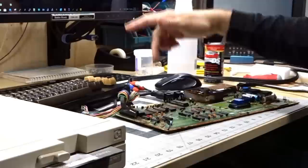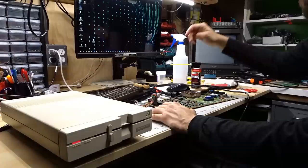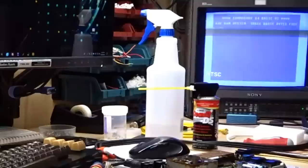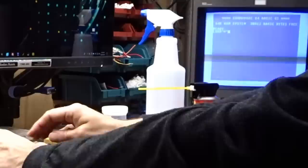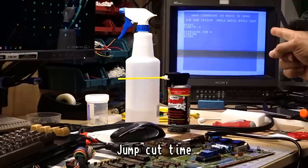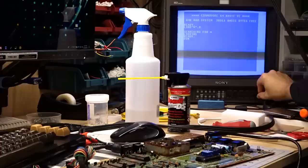It's full-on test time. I have a 1571 disk drive connected to the IEC port on the rusted motherboard, and my favorite SID music disk. The video and audio are hooked up to my Sony PVM. I do have a couple of heat sinks on the VIC-2 chip, just because they get hot. I turned it on, the disk drive accessed, and loaded: LOAD star comma 8. Without Jiffy-DOS this load process is a little slow, but it finished loading. Let's do RUN.